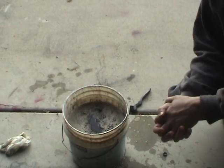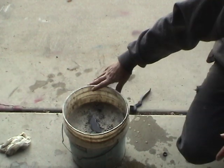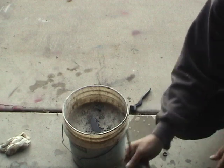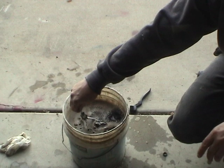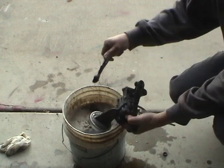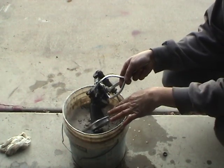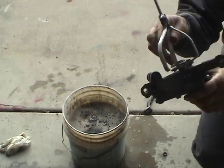I want to show you how to clean an oil pump without taking the whole thing apart. I have a three-gallon bucket with a full jug of Simple Green, which is a natural degreaser. Just let the pump soak overnight and when it comes out it'll be nice and clean. There'll be some spots where you need to get a nylon brush to clean it up. That takes care of the outside.